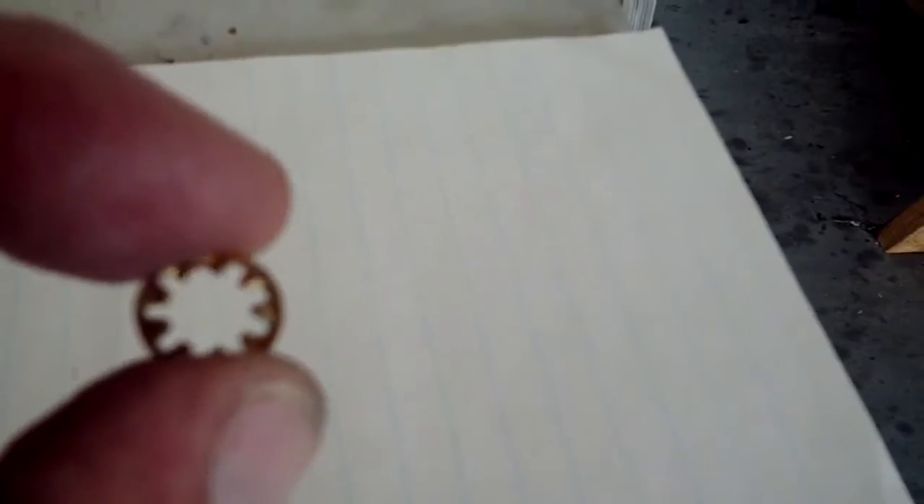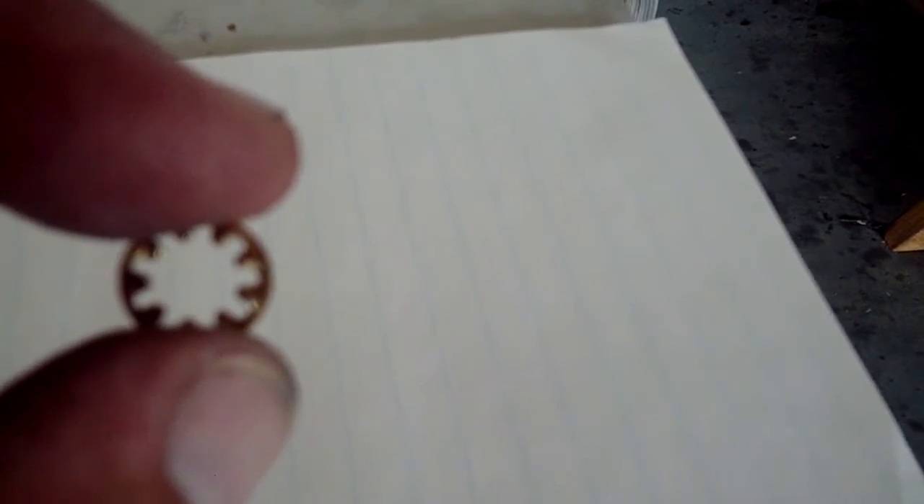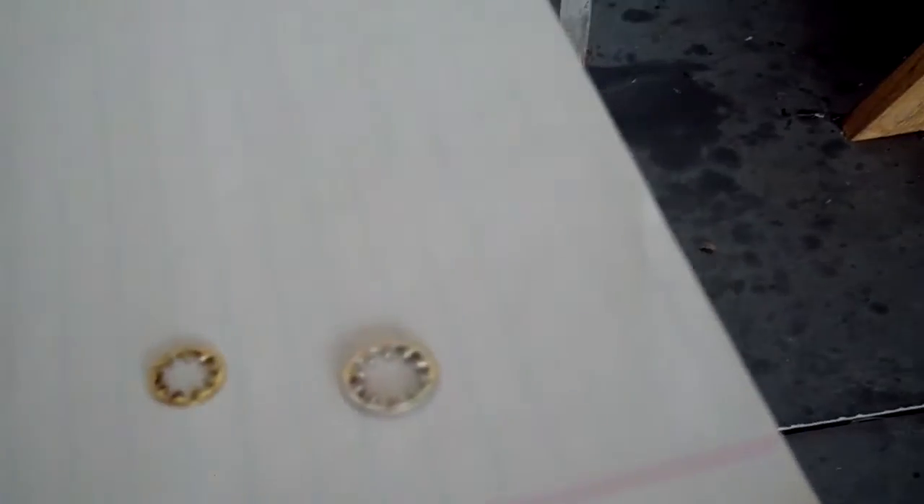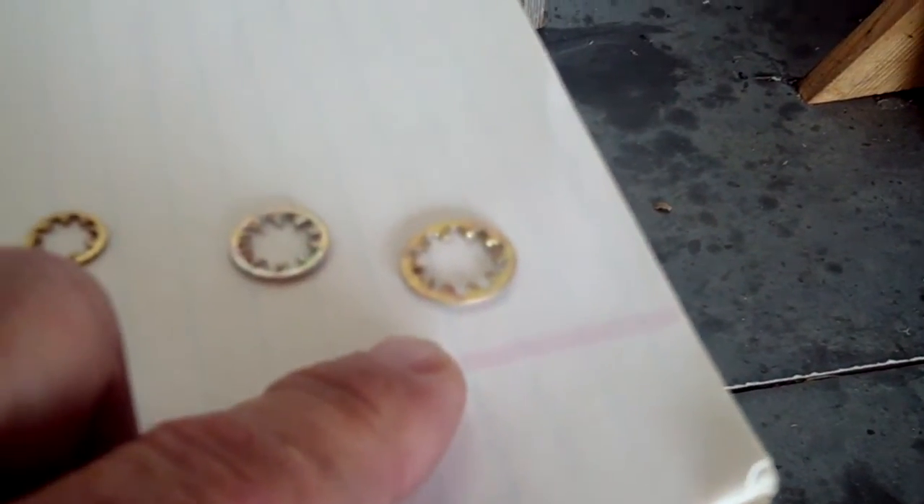There are two types of star washers. The most prevalent that we use on our airplanes are what's called an inside star. These are the MS-35333 series, and they have an unusual numbering system. We use them from number 37, 38, 39. This one happens to be a 40, and it goes on a number 4 nut. The number 41 goes on a number 5, and finally, on very rare ones, a dash 42, which goes on a number 6 bolt. So that's the star washers.